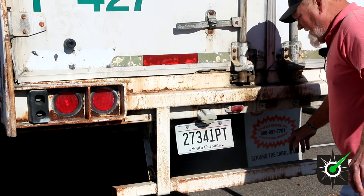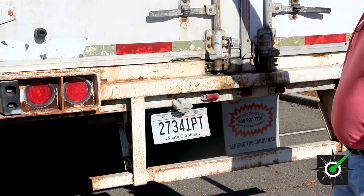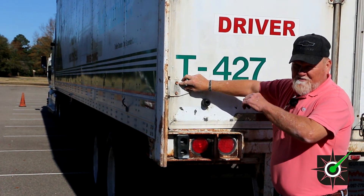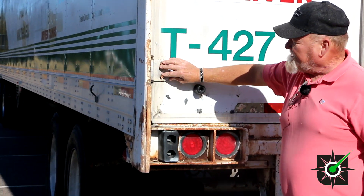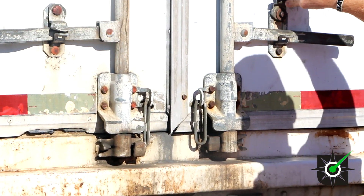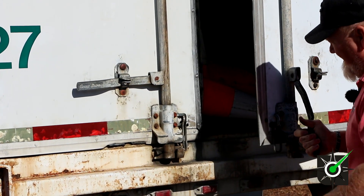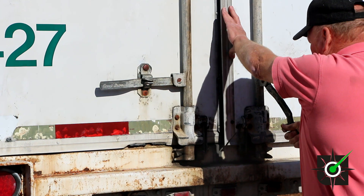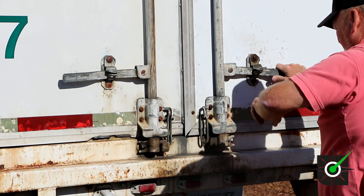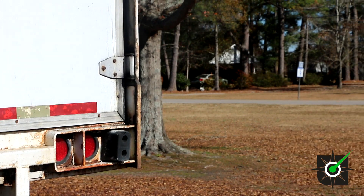Down to the bumper, safety bumper — it's not bent, cracked, or damaged, properly mounted and secure. My trailer doors — there are no holes in the doors, no cracks in the doors. They're mounted with hinges, just like the front door — all the bolts are present and tight, properly mounted and secure. This door is a swinging door — it opens with a handle. It has a rubber seal inside: no cuts and abrasions on the rubber seal. It opens and closes properly. DOT tape on the door. No holes. That completes the pre-trip inspection.